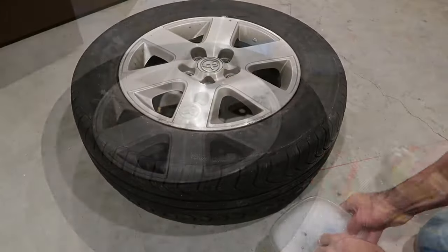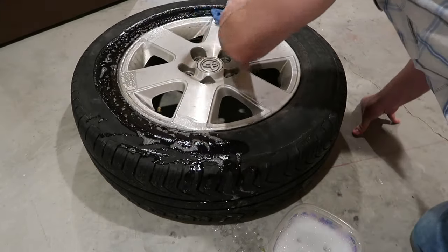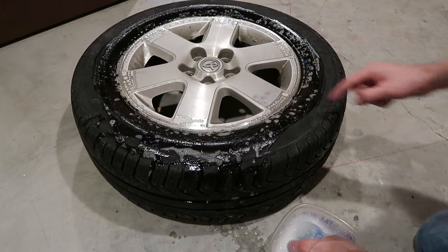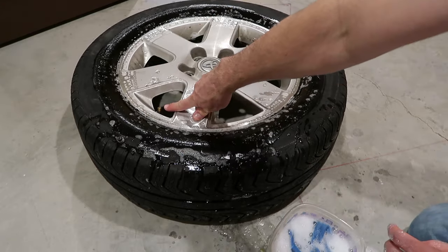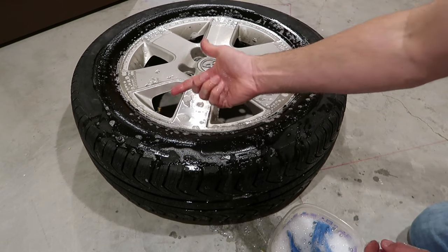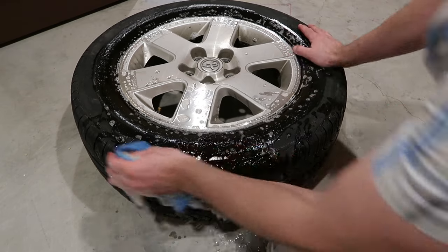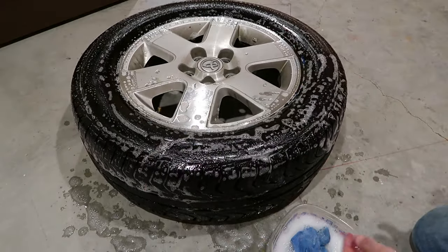What I have here is soap and water, and I'm going to see if it's leaking around the rim. With soapy water, if I have a leak, you'll see a bubble form around here. You can also do it on the valve stem — if in the middle of the stem I see a bubble growing, I know that stem is leaking and I can replace it. But I don't think I have any of these problems; I'm going to double-check to make sure there's only one spot we need to fix.